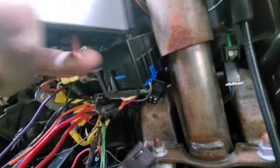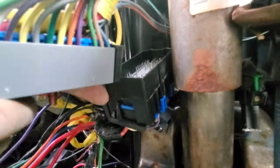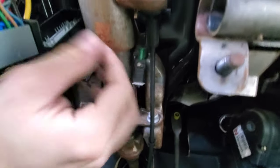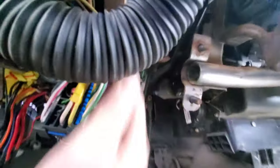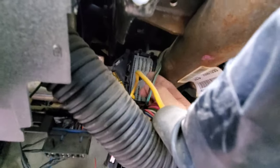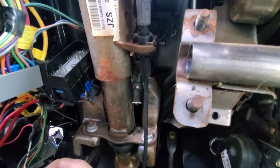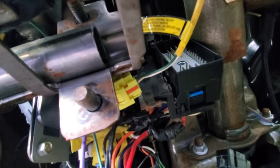I went ahead and separated what looks like the steering column harness — it's just a 7mm bolt that holds those two together, so loosen it off and pull it apart. There's a plug right there that has to get unplugged — that's tied into the steering column harness. There are also two green pins — pull them out and unplug them, and that should be unplugging your whole steering column from the dash. There's also an airbag connection to undo as well.